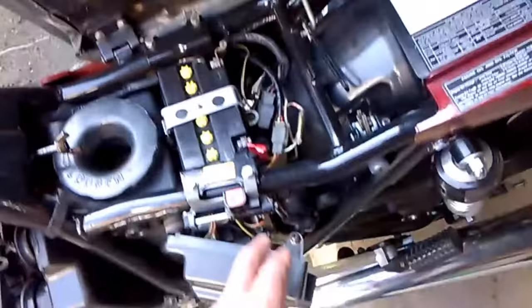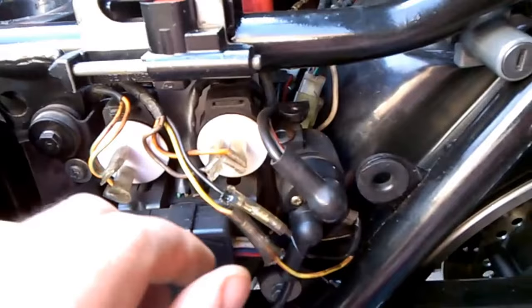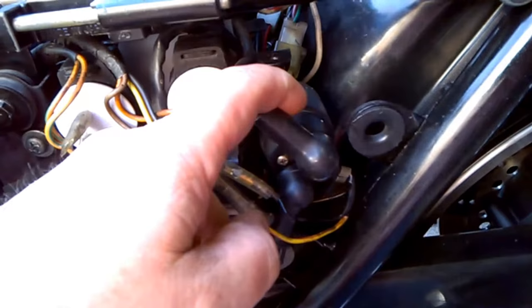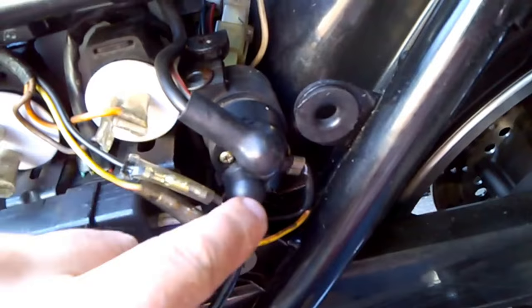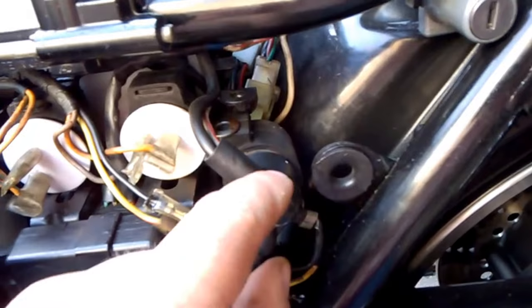If that's okay, something people often think about is the solenoid, which is under the side panel here - here's our panel off. This is the solenoid. What it does is run juice straight from the battery. There's a little electromagnet in there that receives current when you hit the start button, makes an electromagnetic contact inside, basically shorts and makes the contact across these two terminals, and then this wire goes straight down to the start motor.